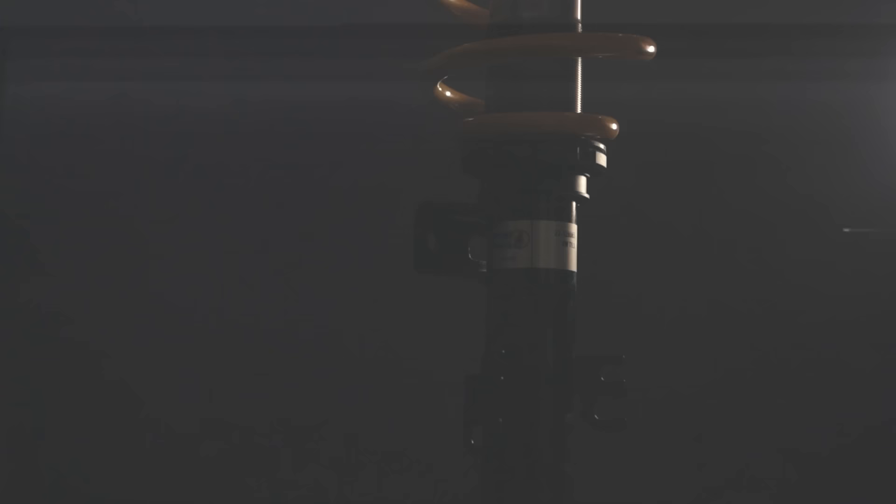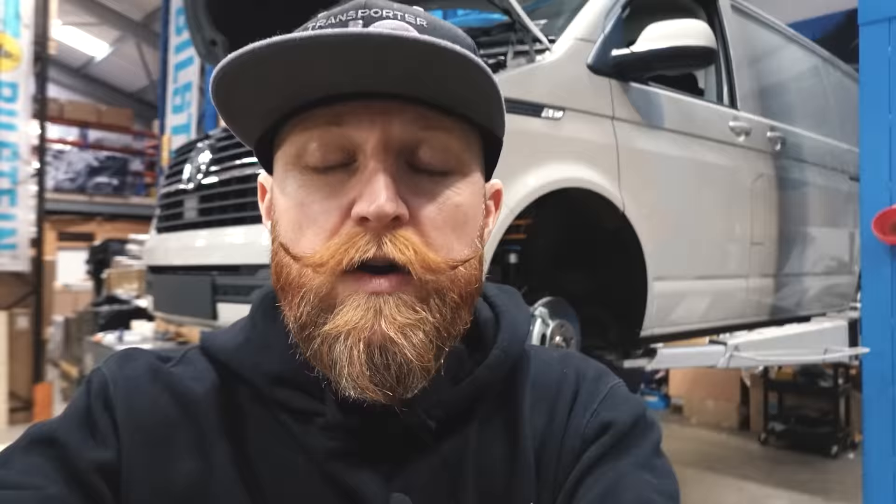This is the one most people have been excited about — the new Solo NSL kit. There's always been a real gap in the market for a damper that sits between your Solo Low and your standard length coilover like the Solo NXT. There are other things out there, but they use a shorter spring while still using the original length damper, which kind of works but isn't ideal. If you're shortening your spring, you always want to shorten your damper.